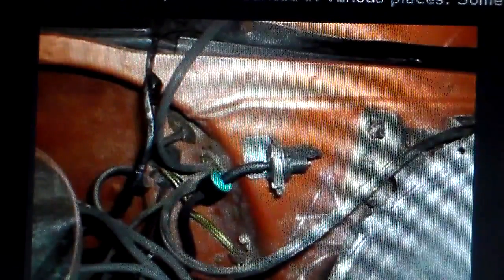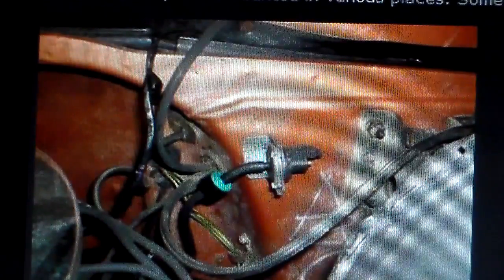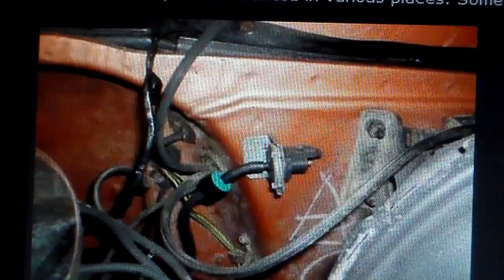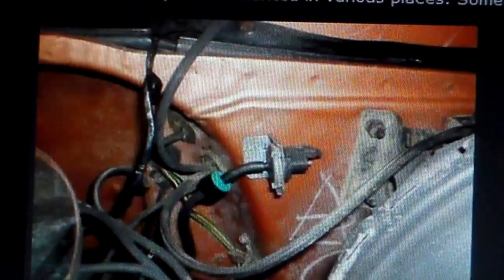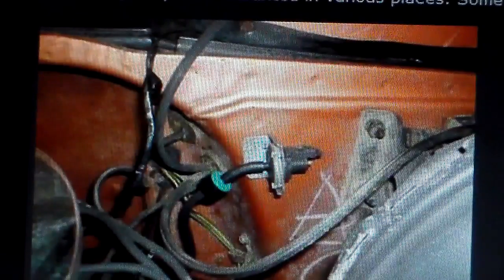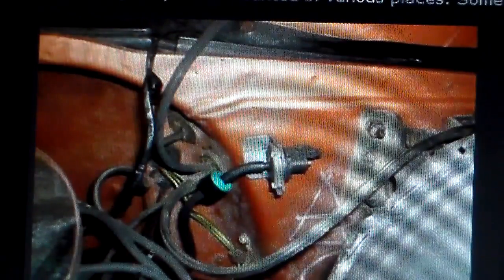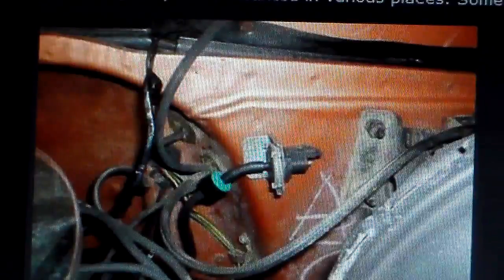This is assuming all your components are in operating order. GM lockup solenoids — there's a solenoid in the valve body that operates the lockup clutch in the converter. These are known to fail; you've heard of Cavaliers and similar cars having that problem. If you hook all this up and it works and then suddenly acts like it won't unlock, go unplug the connector temporarily and see if that condition resolves itself. If it does, you probably need to replace the lockup solenoid in the transmission. It's not a hard job, just messy.